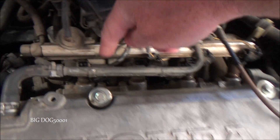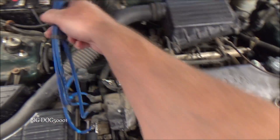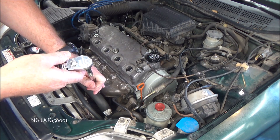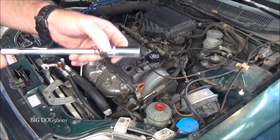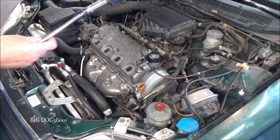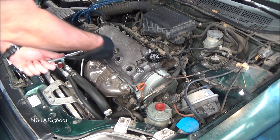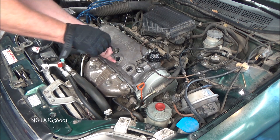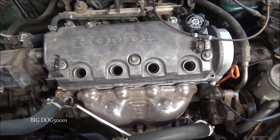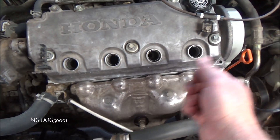All four of them are unplugged — our fuel injectors are disabled. Now we'll go ahead and pull our spark plug wires off. I'm going to pull all the spark plugs out; I just had them out recently fixing the timing belt, so they should come out pretty easy. We're going to need the appropriate socket — in this case a five-eighths inch magnetic one made for spark plugs. Remember, they're going to be hot, so refrain from touching them with your fingers. If the plugs have been in there a while, take compressed air and blow out the spark plug tubes before removing them.